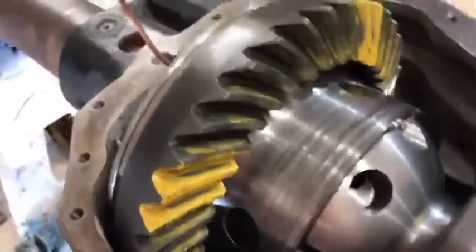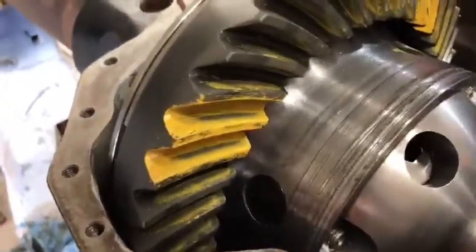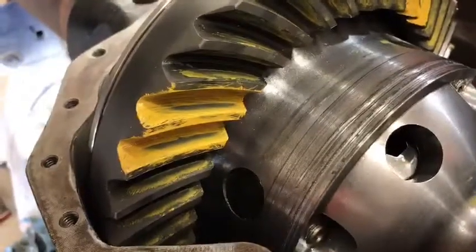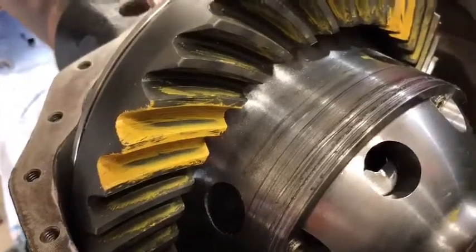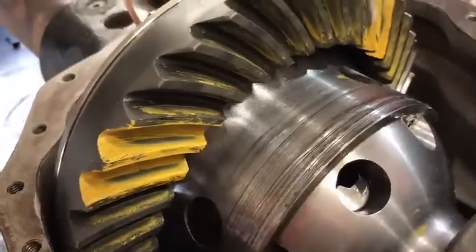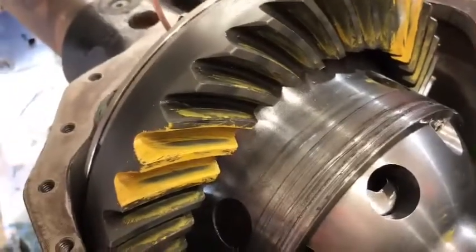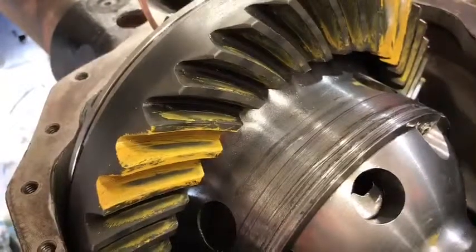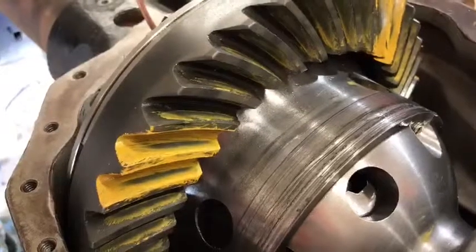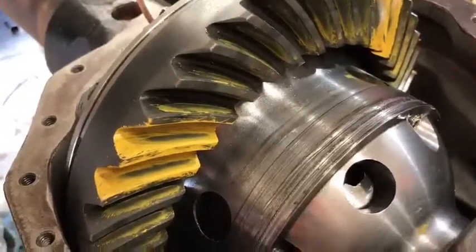Now I'm going to look at the drive side of the teeth. Again, it's not going off the reservation — they appear to be pretty close, centered middle and left to right. If you were super picky, you might say it's a little bit too far to the inside. But for me, I'm going to call that good. That certainly fits in what I would call an acceptable drive pattern. There are a few more things left to do to finish this installation up, but ultimately I think that's where I wanted to end up.